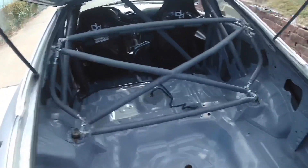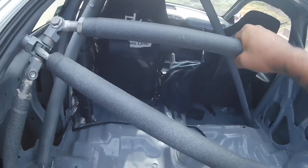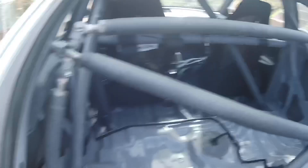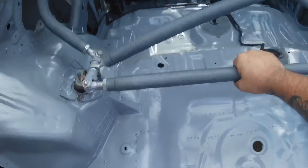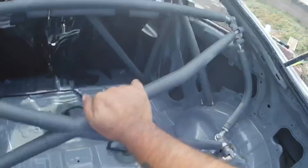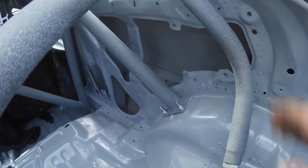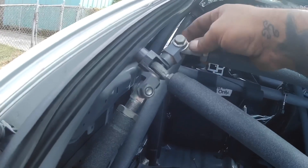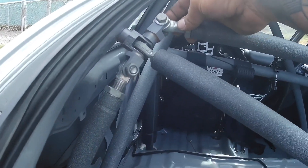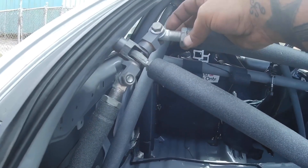Next project up for today is this X-bar. This thing rattles like crazy when I'm driving and it pretty much makes me nuts. You've got that one there, this one that's kind of loose, this one's good, this is good, this one kind of rattles. So basically I'm going to take these bolts off up here and force a washer in between the bracket and the actual threaded part that comes out on the bolt.